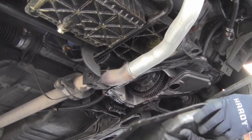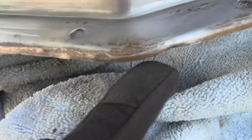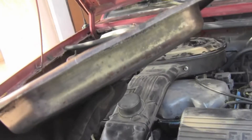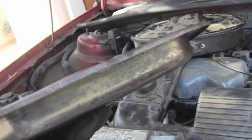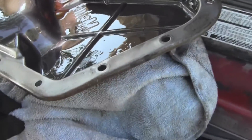So just to inspect the inside of the pan — a little bit of metal shavings, but nothing too out of the ordinary. Now there is a little bit of damage here and I don't know if that was what was causing it to leak, but it might have been. I don't see any other signs of damage or any other spots that really worry me. Might be a little bit of an arch right there — might just whack that a few times with a hammer, because it did look like it was leaking out of the back.